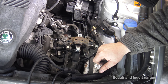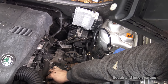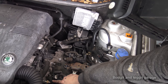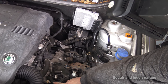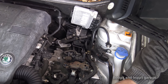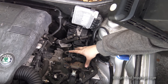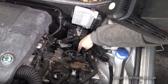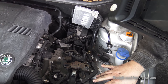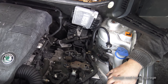There are a couple of things to bear in mind: this bolt here holds the engine mount, the top gearbox bolts, but it also holds on the starter motor - and not only that, it also holds the earth strap. It's very important to get your earth straps back in the right place, because either the car won't start or you can even cause a fire. Also took off the slave cylinder - two 13 mil bolts. The reason I did it that way is because we don't have to bleed it afterwards. You can disconnect it from the back but that means you have to bleed it. Now we're going to lift it up and take off the driveshafts.